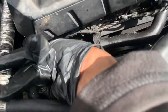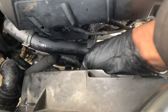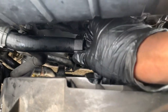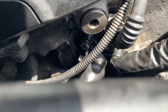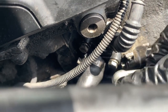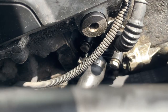Put the coolant hose back in the channel where it clips in and put the clip back. Tighten the two 10 millimeter bolts — they were already hand-threaded, so use a wrench and do a couple of turns on each side to make sure the coolant hose seats properly.